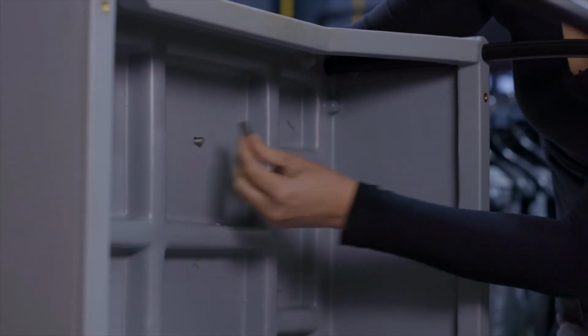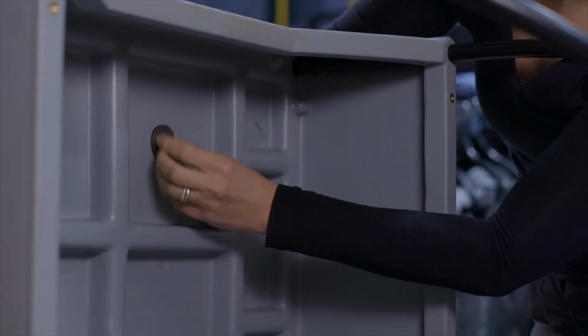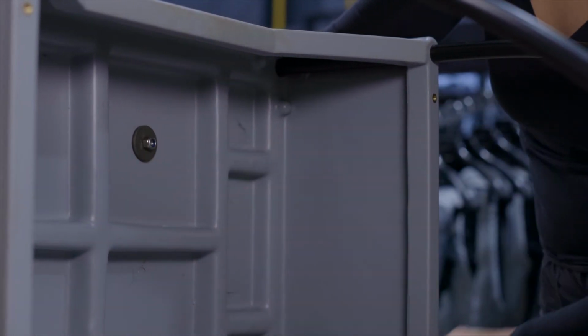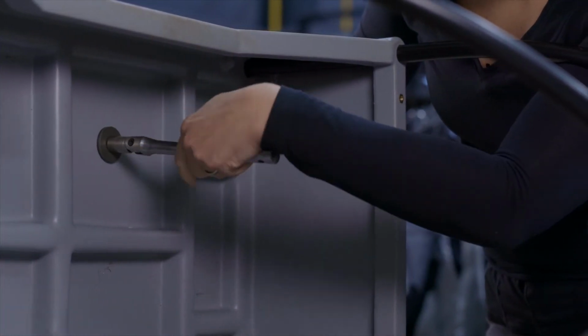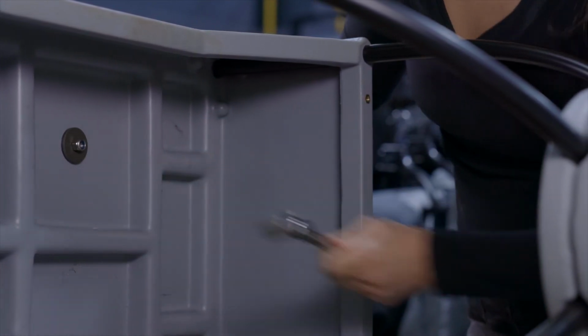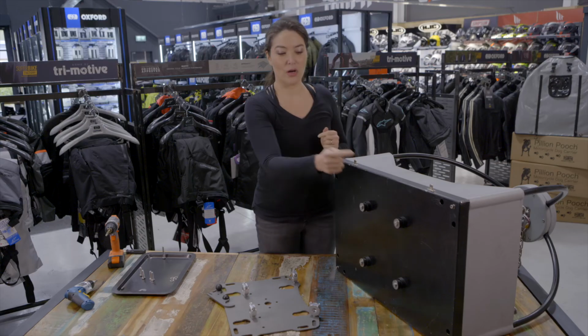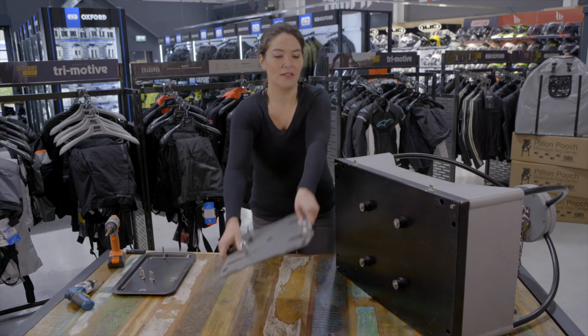Take the BRE washer and an M8 nylock nut and screw the nut onto the bolt thread. Repeat this for all 4 pucks. With all 4 in place, the Pillion Pooch will now slide onto your BRE.